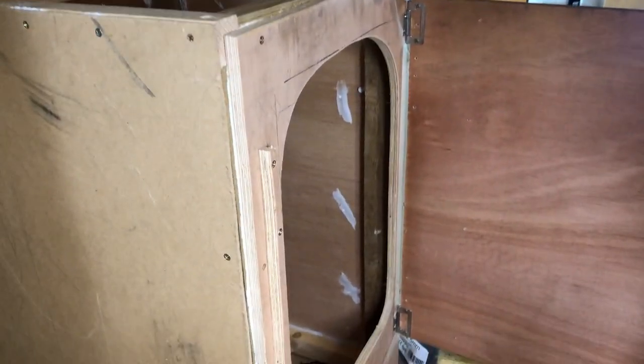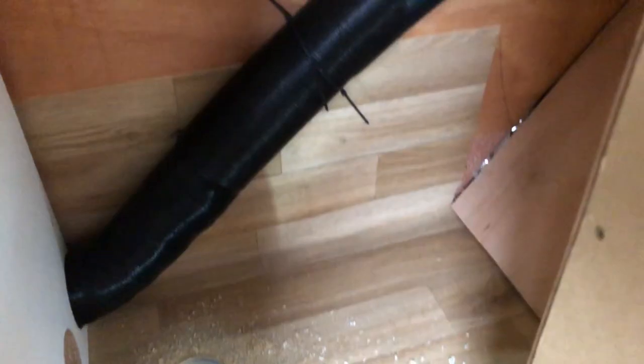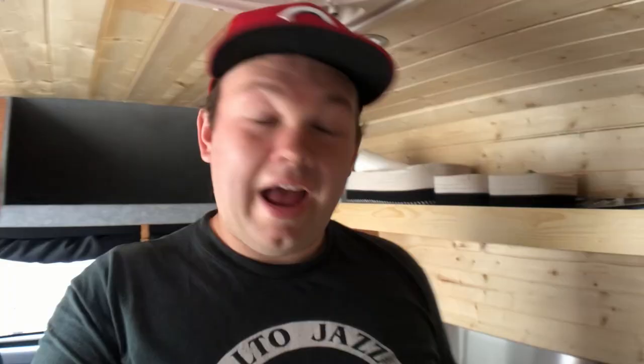It's a new day and I'm really excited — I've almost got the gas cabinet in now. This is the cabinet itself, there's the door on it, I've got some draft excluder coming to put around the edge. It's not pretty but it's functional. Down here is the dropout vent, there's the heater pipe going out the side, and the cabinet itself fits perfectly in that little square just in front of the rear wheel arch. I'll show you underneath where I've cut the hole.